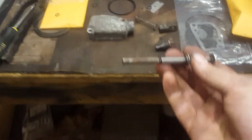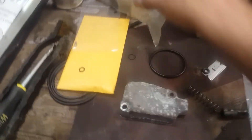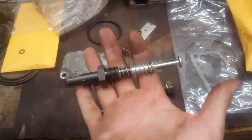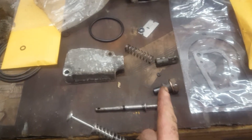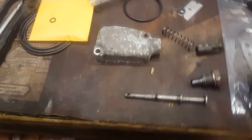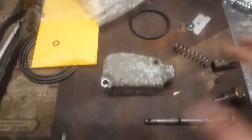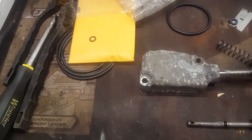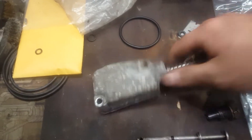It doesn't take much force — this bends really easily, so be careful not to bend it too much or snap it off. Fortunately, replacements are still available from AMBAC themselves. It comes nice, shiny, and fully assembled. All you've got to do is put your new copper o-ring on there, or you can reuse your old one — this isn't a super high-pressure area. Then you just screw it into your old housing, assuming it isn't damaged.